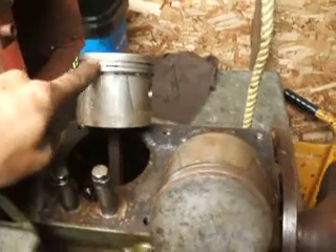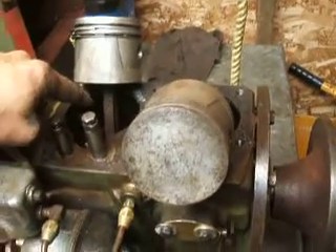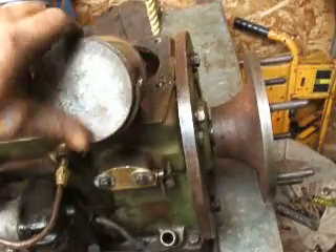These rings are all loose. The head is not pivoting very good on that connecting rod. This one here pivots okay, but all the rings are tight. So I'm going to loosen those up.